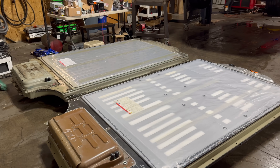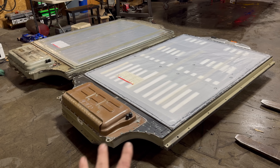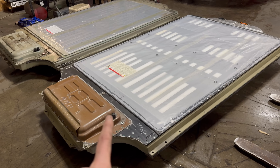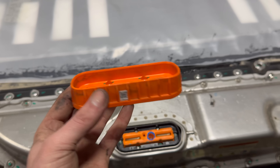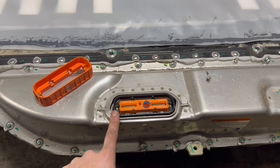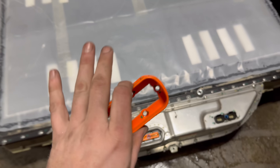We're going to be swapping that pack into the car. I'm going to give a brief overview of the process — I have a very detailed video on the 100 kilowatt-hour pack swap that I did on my personal car, a 2015 Model S 70D. There's really only one modification needed to the pack in order for it to fit: swapping out the ring around the high voltage rapid mate connector. The old one is this orange ring, which is slightly taller and meant to fit the rapid splitter system. The older cars use a different style high voltage rapid mate with a lower seal surface. That's just a part that bolts on — super easy to swap out. Everything else about this pack is fully bolt-in.